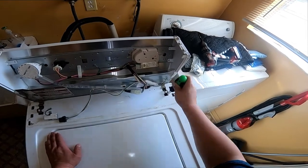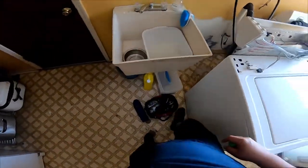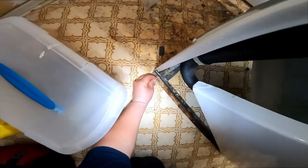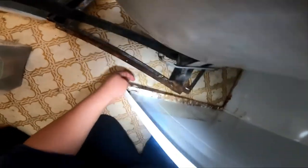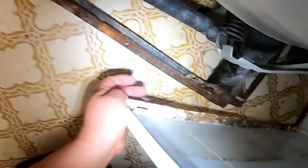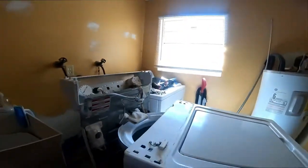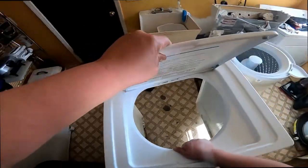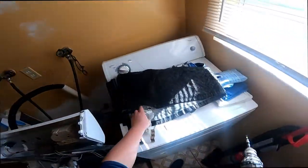It will release from those male-to-female connections. There are clamps — you stick a flathead screwdriver in and those clamps will come right out. Next, remove the cabinet. As you can see, there's another male-to-female connection right there. There's the female connection, and it should align with the back connection. Sometimes those are bent over but you can straighten them with needle-nose pliers. There are also two more connections in the front. Aligning the cabinet correctly means it won't be wobbling once the washer is back together.